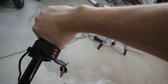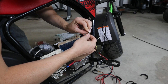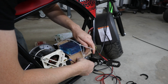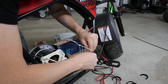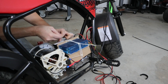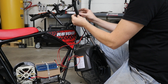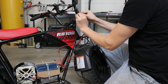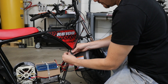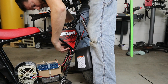The voltage meter was showing about 23 volts — those old free batteries had a little bit of wear on them. I made a couple holes in the battery mounting plate so I could use zip ties, which let me take the controller on and off easily. I used a little piece of cardboard to make sure the controller box didn't touch the battery terminals since I'd lost my plastic cover. I coiled the wires up nicely and used the snap plates on the minibike frame to tie them out of the way.